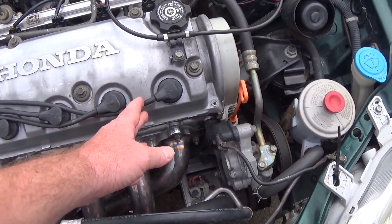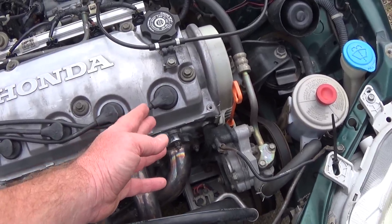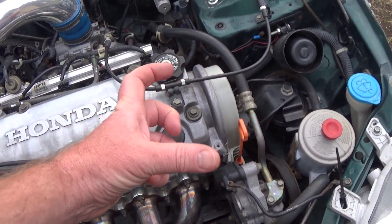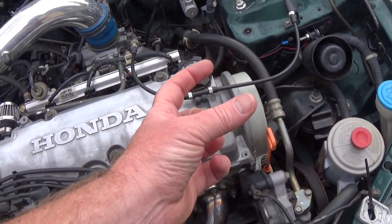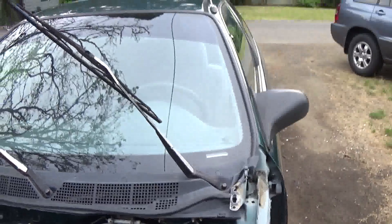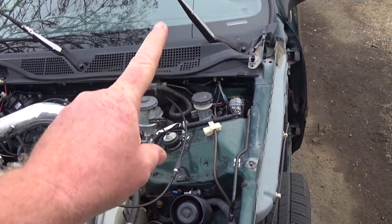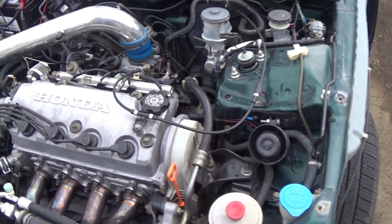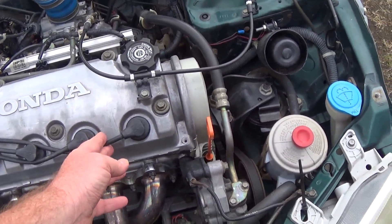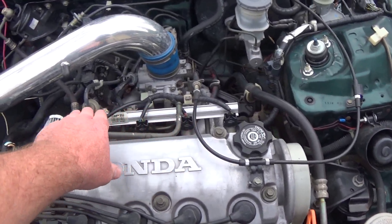There's an old mechanic's trick. I have a timing light and I clipped it to the number one cylinder and put the leads on the battery. Then I used one of those hand vice things to depress the timing light trigger and sat it right here, so that when I tried to turn it over, every time the number one spark fired I'd see the light flash. So I knew I felt like I was getting spark. That was my determination — it would only fire if it was getting spark there. So I was pretty confident I was getting spark and started suspecting I wasn't getting fuel.